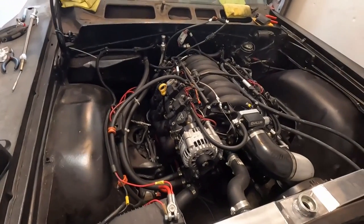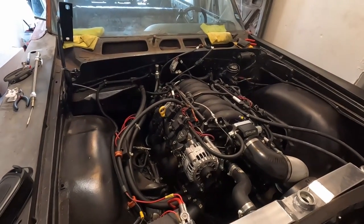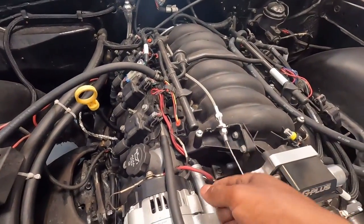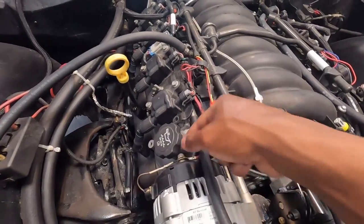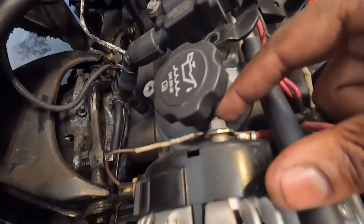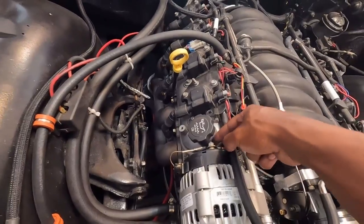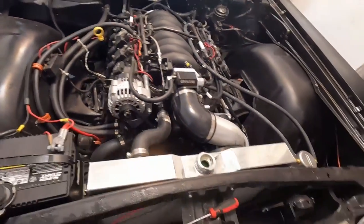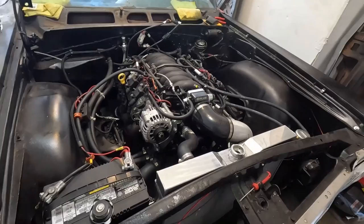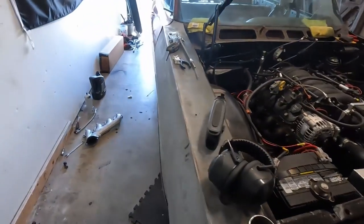This is honestly a simple LS1/4L80E setup — it took a lot of research to get figured out but it works just fine. This alternator bracket was from the stock 350. I think the only thing I had to do was cut just a tiny bit off the back end of it because of a piece of the valve cover. The Holley Terminator X Max pretty much self-tunes. Catch can, 4L80E — let me see if I can get under there for the bracket.